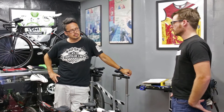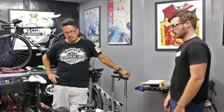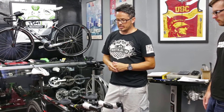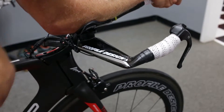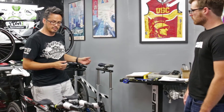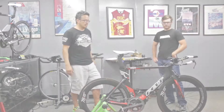We're talking about stack and reach — how is that determined on bike? Basically, every bike is designed on an X and Y coordinate: stack is based on the head tube height and reach is based on the entire cockpit. We measure the rider's upper torso, and we can use the exit fit cycle to measure stack and reach, or we can use a tape measure and grab one or two bikes that are approximately close.